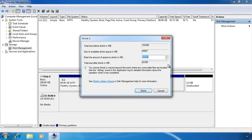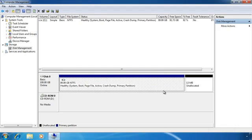You will only be able to shrink the hard disk according to how much free space you have. If you find that you can't shrink the hard disk down as much as you thought you could, you may need to defrag the hard disk first. Defragging the hard disk will move all the free space for the drive to one location at the end of the drive. In order for the shrink command to work, the free space must be at the end of the hard disk. Before you shrink a partition, however, you should back up your data.